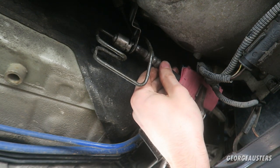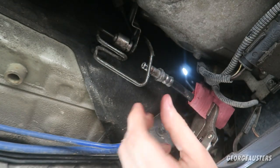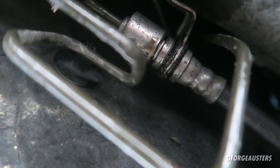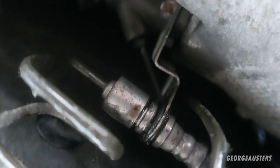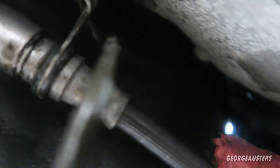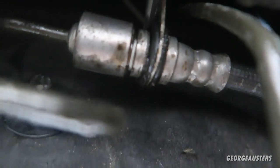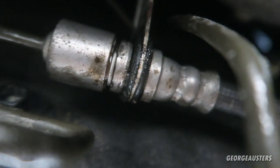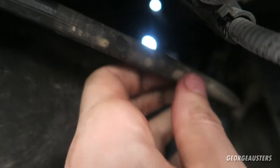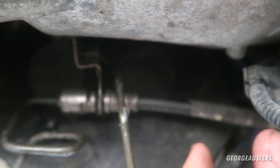All that's left to do is slide this hose into here to form a fixing and then put the clip back on - and that is essentially job done. I've gone ahead and put everything back together. We have the hose going straight onto the fixing for the slave cylinder now, with the clutch delay valve completely removed. I've put the clip back on underneath just to make it easier to remove if needed. Now all that's left is to remove these vice grips. The hose is not damaged, but we will need to give the clutch fluid a flush just to get any air out of the system.